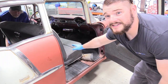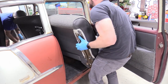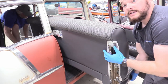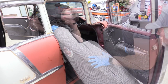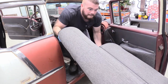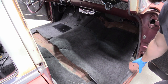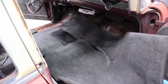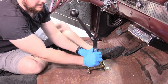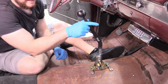I've got all my mounting hardware disconnected, so now I can take the seat out. Depending on your seats, you might have buckets, but I have a bench, so it has to come out all as one piece. Typically when you remove carpet, it's held in place with trim around the door seals and maybe even glued in, so you might have to defeat that. Pulling our carpet out reveals our transmission tunnel. I've got our pilot holes drilled out — I can verify they're correct by putting the shifter on. Those all line up, so that's perfect.